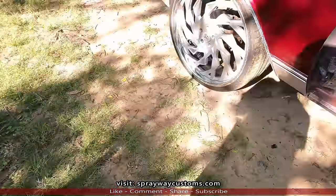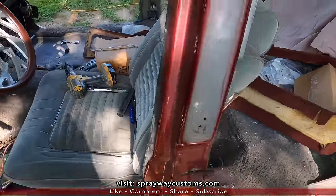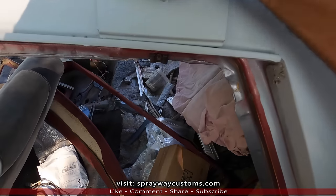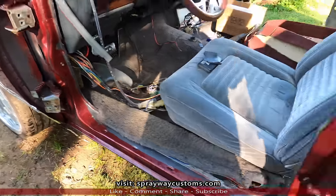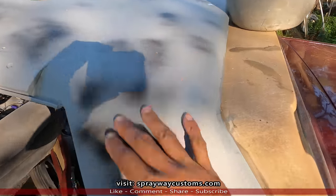Now I take the car up, clean up everything with some soap and water. And I also put a guide coat on this primer area here so I can block it. Finished up washing everything with the jams. Also the top, about to start wet sanding. You can see the guide coat on it.